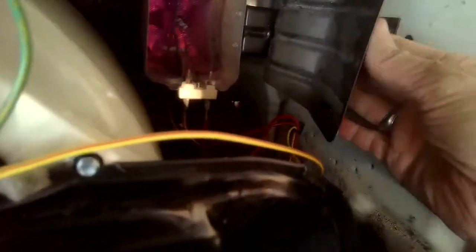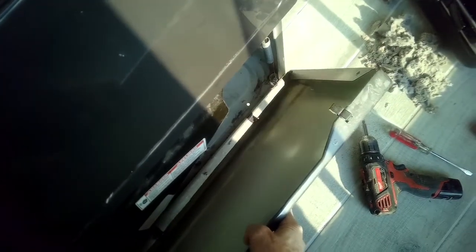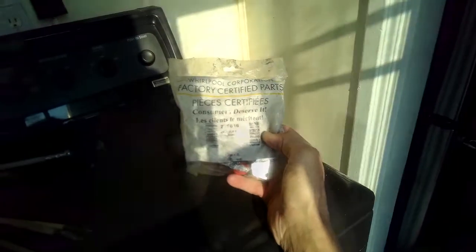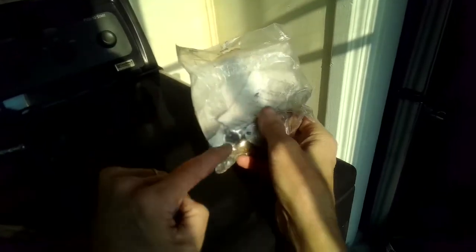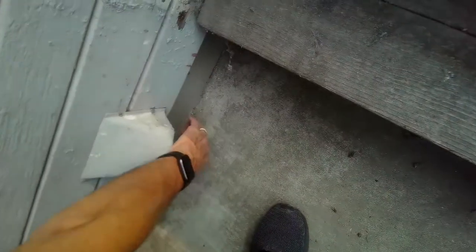Go ahead and bend this heat deflector back to where it was, then add the front plate back in. It goes onto the little clips on the bottom and top clips, and they just snap into position — super easy. Here's the part that you can replace that's very common to fail. Sometimes the heating element goes out, but it's usually that thermal cutoff part. I checked the outside vent and the dryer airflow was really good, like a hairdryer.